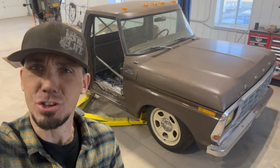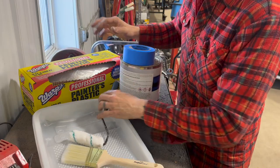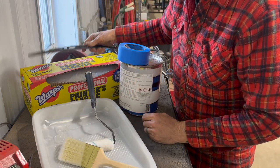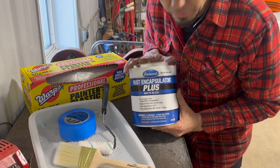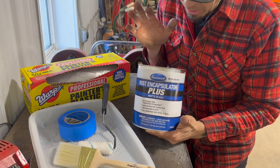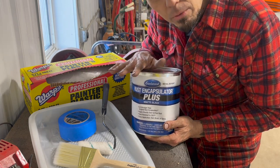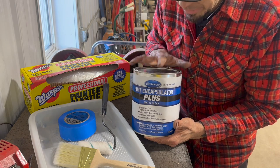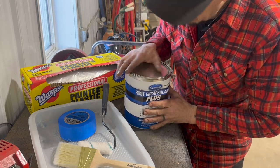We're ready for paint. We got painter's plastic, masking tape, a tray, roller, brush, and something to use as a stir stick. What are we using today? I'm going with Eastwood Rust Encapsulator Plus. Eastwood is not a sponsor, but that'd be really cool — I'm really impressed with anything Eastwood sells. I'm looking forward to sealing out any moisture and oxygen to that rust so it doesn't continue to grow, and this will give a nice surface when it comes time to put sound deadening down on the floorboards.